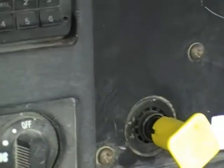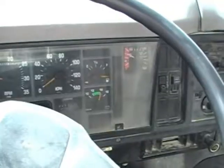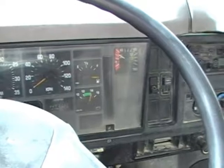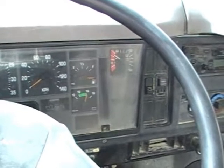And there it is. We put the vehicle in gear and perform a tug test. The tug test involves releasing the clutch ever so slightly. The lack of movement of the vehicle indicates that the parking brakes are on. We then return the transmission to neutral.